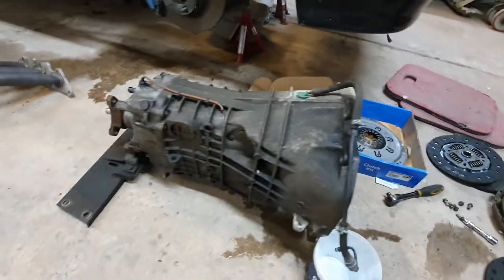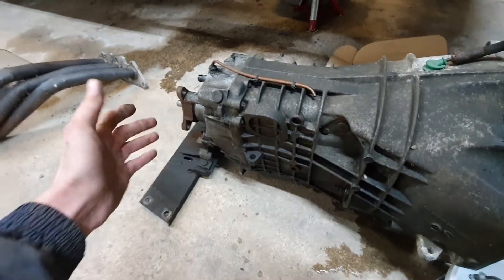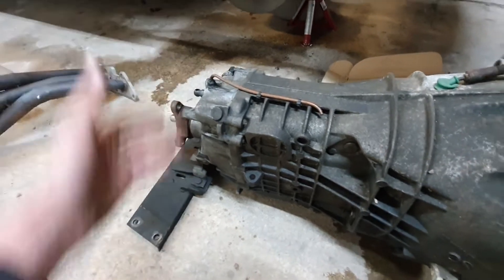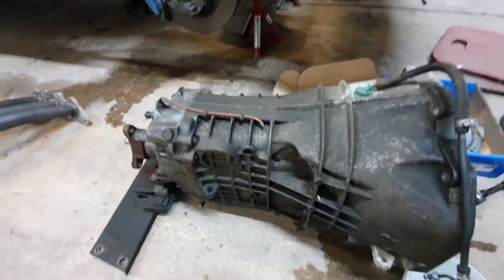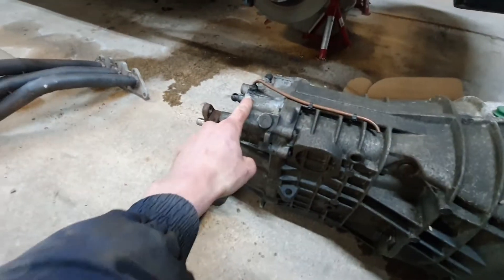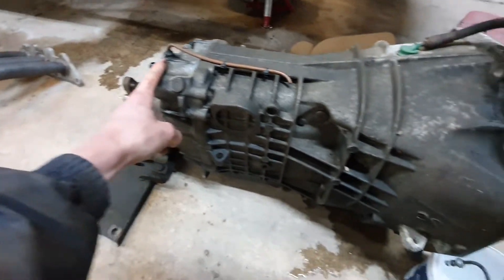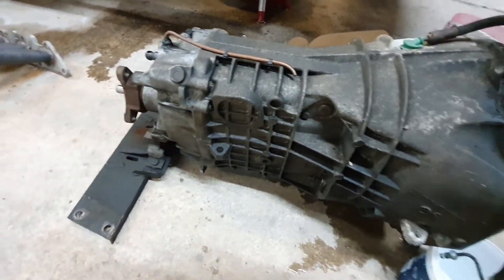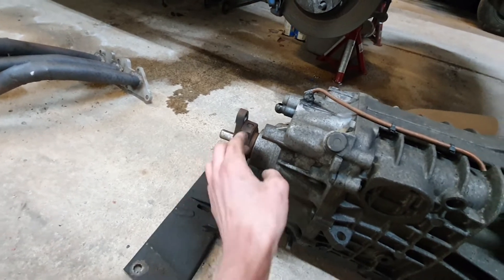Here's another interesting problem I found with this gearbox. It's a lovely gearbox — the Omega gearbox — and of course the gear stick doesn't come out the top of the box like it does on older boxes. There's a linkage on the back so it can be shortened, which is fantastic because you can put the gear stick wherever you like. It's got a breather here at the back — as with any axle, when there's heat generated in a gearbox, air expands and it needs to come out, otherwise it'll blow the seal. I'm very pleased to see that is perfectly intact — there's no oil leaking at all.